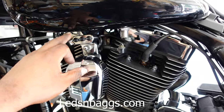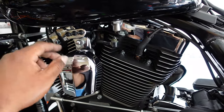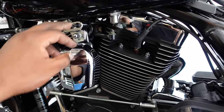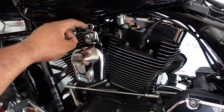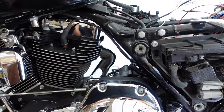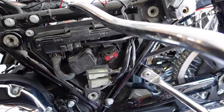But this particular switch I have on and off on the front. So it's just a toggle, on, off, or off, on, however you set it up. The middle is going to be my center stand, okay? And then the rear, the back switch is going to be my air ride. Now, I have it wired to where the bike has to be on. So without the bike on, nothing happens. See that? Nothing happens. So that's good. Nobody can just come and put your bike up, whatever the case may be. Now, we're going to cut the bike on.